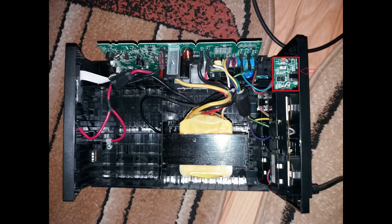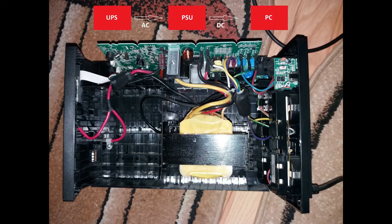This is the power distribution board from the back of the unit. This is the main board. And this is most probably a step-up transformer with laminated iron sheets. It converts the electric current from low voltage high current into high voltage low current, so the transformer's output voltage will be greater than the input voltage while the intensity decreases. The transformer can transfer electrical power from a source of AC current to your computer, and then the power supply unit inside the computer converts clean AC power from the UPS into low voltage regulated DC power.